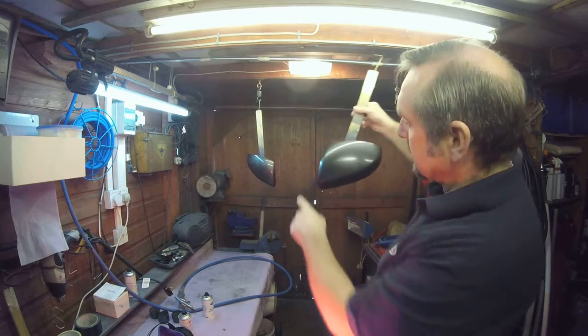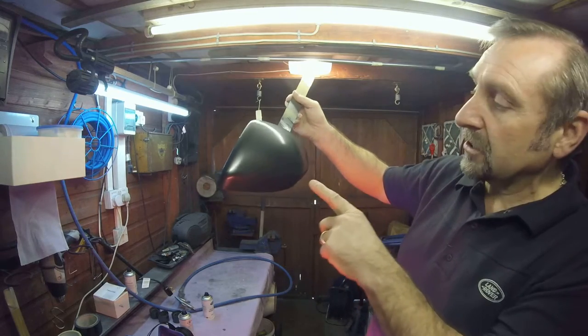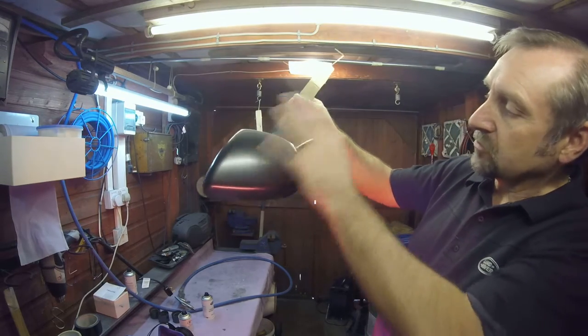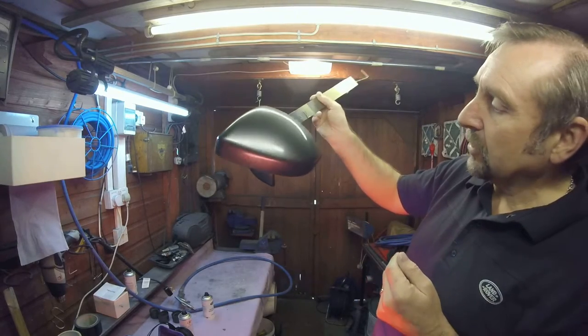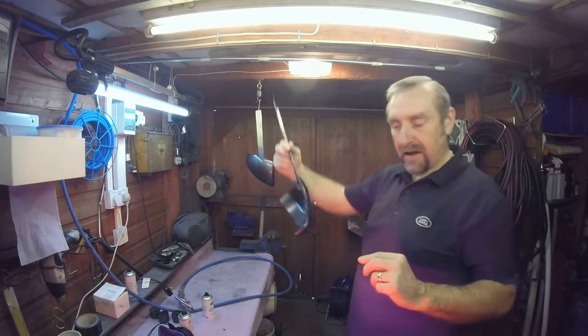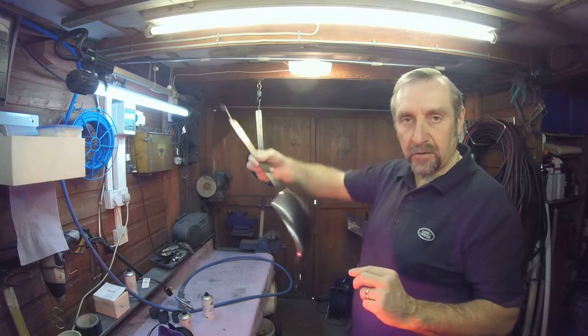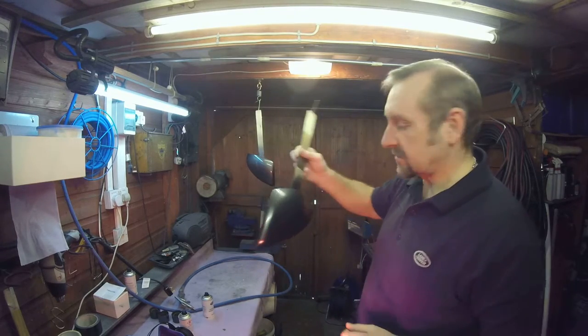As you can see in relationship to that one, this one's now starting to go dull. But if you look, there's no mottling. It's one nice, even metallic coat of paint. Got no blotchiness, no runs, no wet edges, and this has been having it on the lollipop that we can keep going and put lots of nice thin coats.